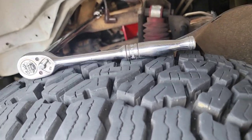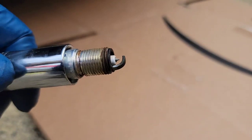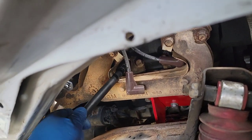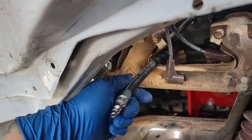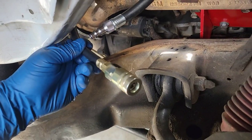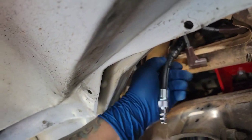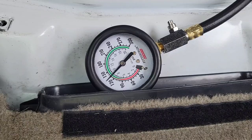That long extension really helps when you're trying to work inside the wheel well. Spark plug number four — it's the middle one on the passenger side. Looks good to me. I'm just trying to get this threaded in here with the camera left-handed. The idea is you screw this in until it's real snug and then you hook up the quick coupler. You can hear the sirens in the background because this is Los Angeles — it's like a war zone here, every day all day and night. All right, here we go, number four.